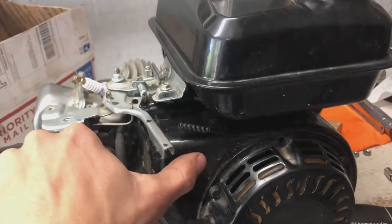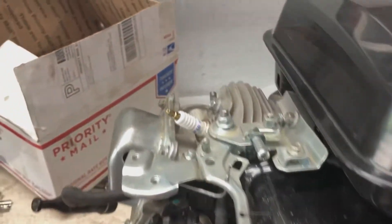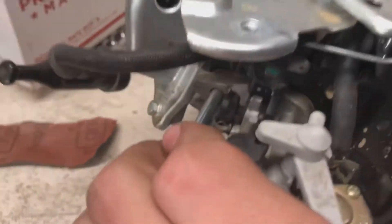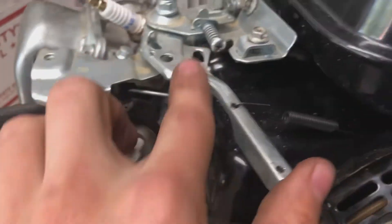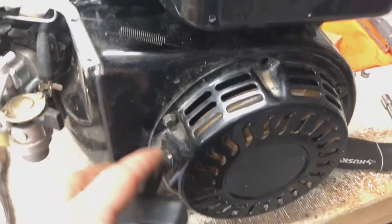I made up a throttle system. I just reused the stock governor throttle spring and kept that. You see how the throttle screw there is still there? That limits the throttle cable from overextending, so there I got full throttle now. The throttle rod stays nicely in place, spring stays nicely, and it doesn't interfere with the pull start.